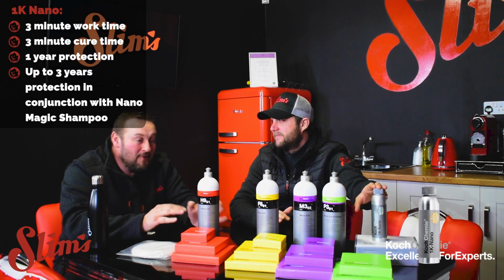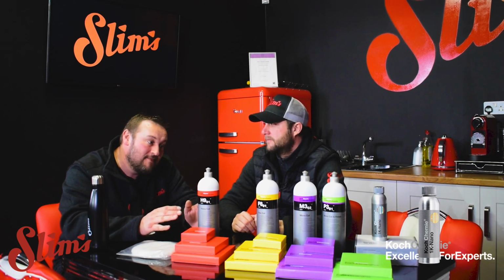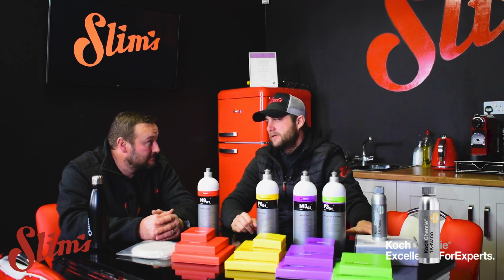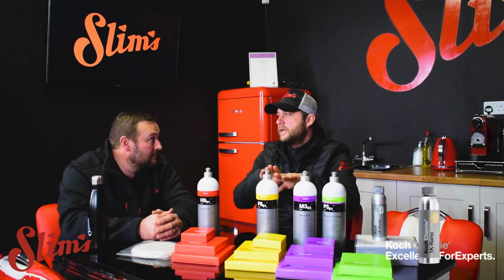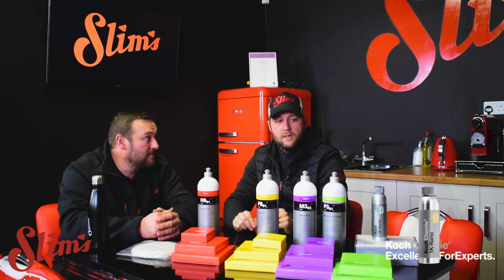Mate, I love to apply that with them pads in front of it, you know. Nice slow speed, 3-minute work time, 3-minute cure time, buff off, driving away in 3 hours. Yeah, dual action polisher with that. Very quick. Yeah, really slow speed. And I know you like using the dual action with this because it gives you a nice level, no high spots, nice level, clean finish. You can generally do a panel at a time, more than comfortable.